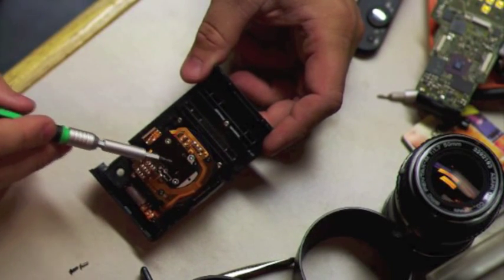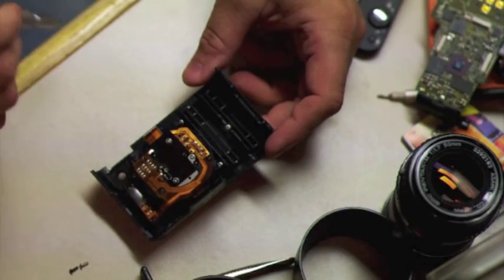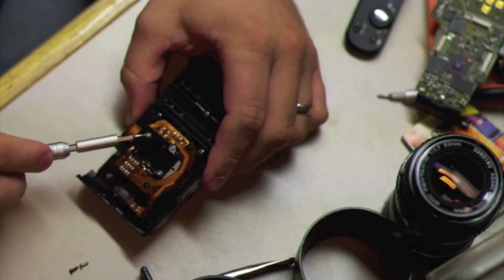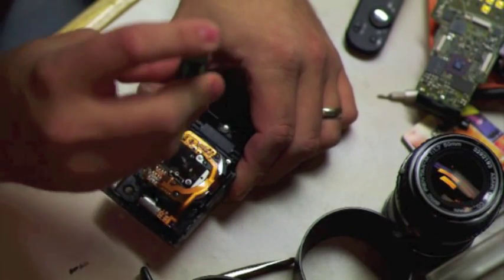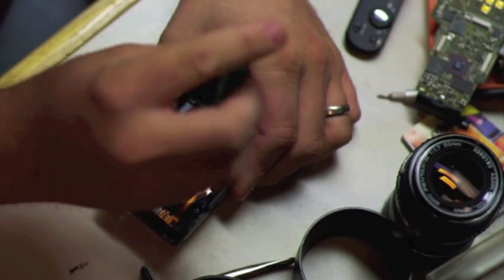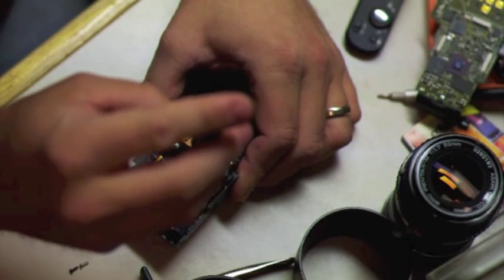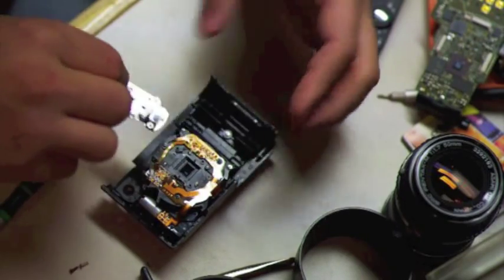Now what we have here is the lens and the sensor. The sensor is this piece right here, and this is the one we need special tools to take out. You don't have to take the lens off — I accidentally did that the first time and messed it up. There are three screws holding the sensor on. I'll just take those out — these are the little special hex screws. Once you get those, the sensor unit just comes right out.